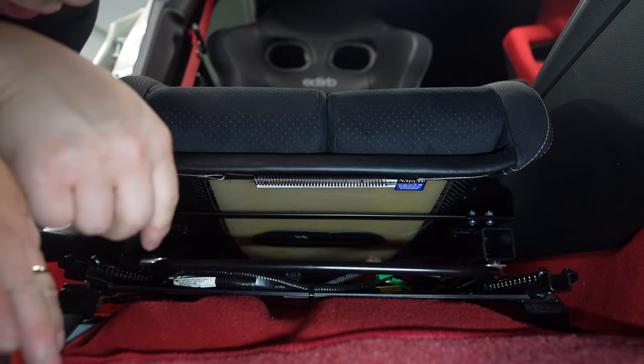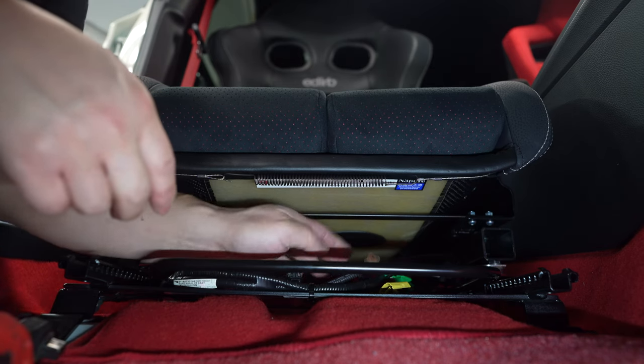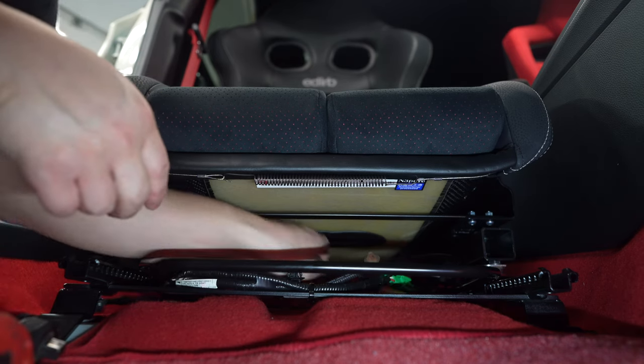So now I got the seat bolted in — everything is nice and it slides properly. Now I'm going to go ahead and plug in the factory plugs. Don't forget your airbag canceller — it is a 2.2 ohm for the Civic Type R. So I'm going to plug that in. Now we just plug in the seatbelt and passenger sensors. I'm going to go ahead and zip tie it so that it looks more presentable, more OEM look. Just go ahead and try sliding the seat back and forth to make sure everything fits properly. Then we're going to do the driver's side.